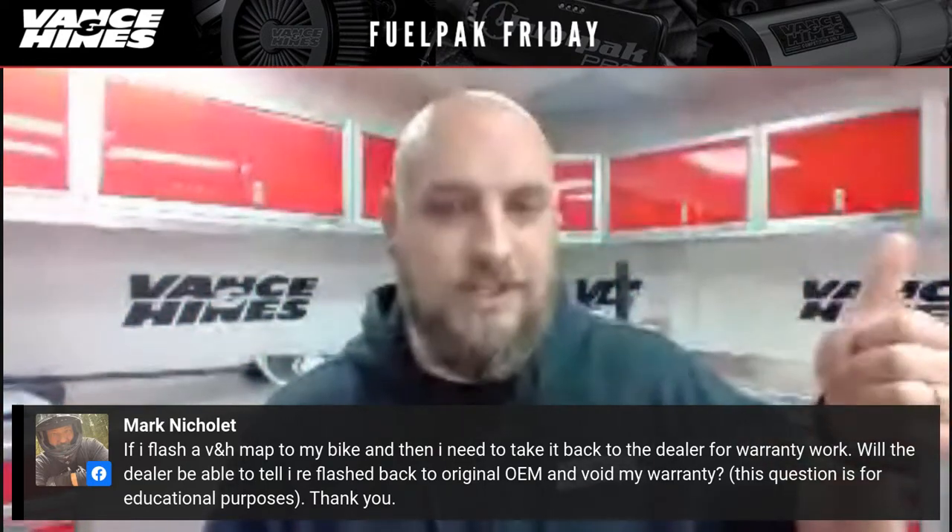The third option is people living at high elevation. If you happen to live in Denver, Flagstaff, or anywhere above about 5,000 feet, it's a good idea to run auto tune so your automatic fuel trims aren't having to work so hard to keep your bike running optimally. You want your bike tuned for its everyday normal use. Down here near sea level, if I go to the mountains the automatic fuel trims will lean out the mixture as needed, but since I'm not riding there all the time it's nicer to have that as an occasional adjustment.